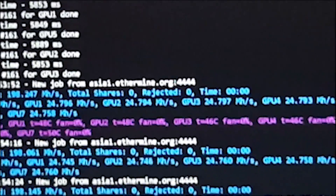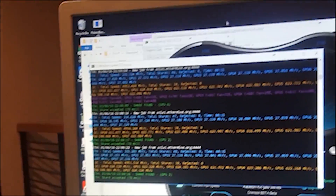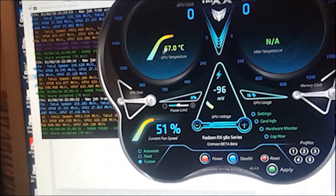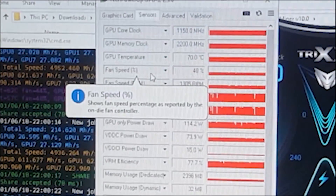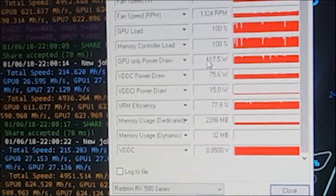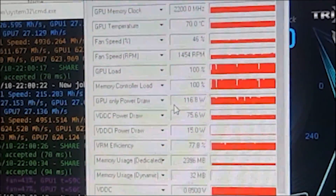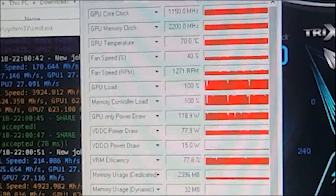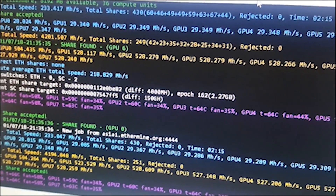Although I was a bit underwhelmed with the stock hash rates, I started overclocking the cards until I was able to get pretty decent hash rates. This was dual mining Ethereum and Siacoin. The reason why you're seeing zero values on my core and memory clocks is that I entered the overclocking commands on my batch file — tuning the core and memory clocks using MSI Afterburner or Sapphire Trixx doesn't seem to work well with the AMD blockchain driver. I undervolted the cards by negative 104 voltage, and it's pretty much running on less than 120 watts per card. A little bit more tweaking and I was already hitting 29 to 29.5 megahashes per second.